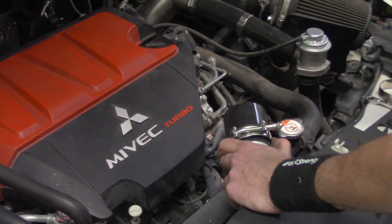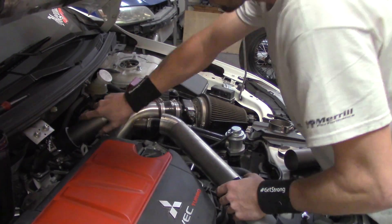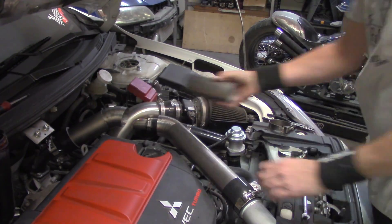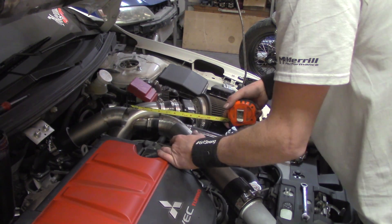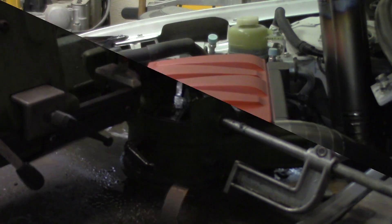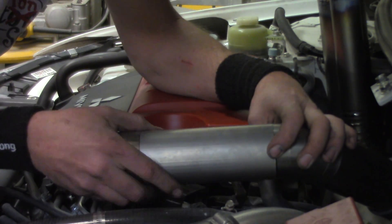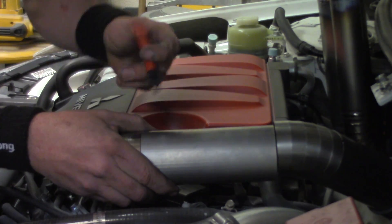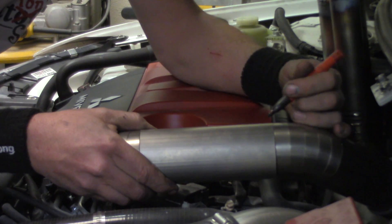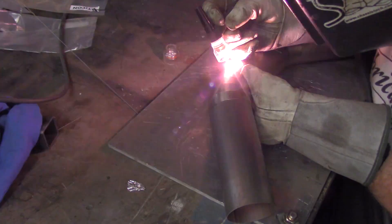We'll get it set up on the car — one on the intercooler inlet and one on the turbo outlet — and now you can see all we really have to do is fill in the blanks. I'm going to take a measurement, set it all up, get it cut down to length, and we're ready to roll. This tube does have a seam on it, and I want to make sure that it's out of sight. So we're going to point it down and fill in the orientation marks here — one mark down below, two marks up top — which removes any kind of confusion about where it's supposed to land.